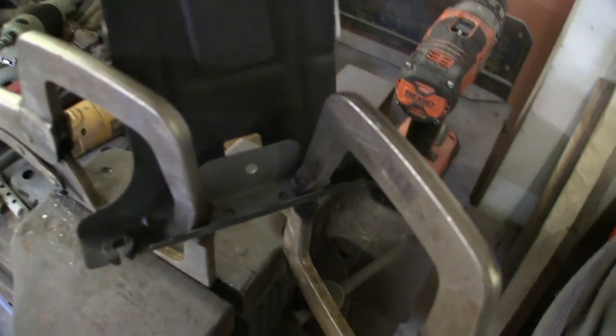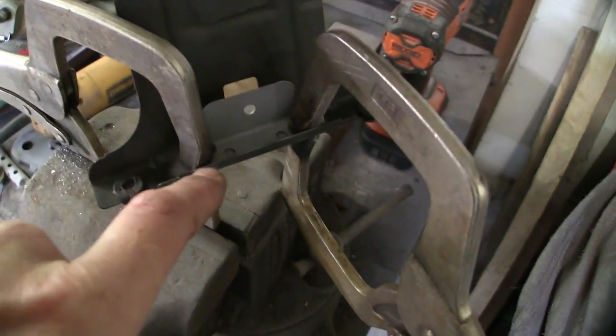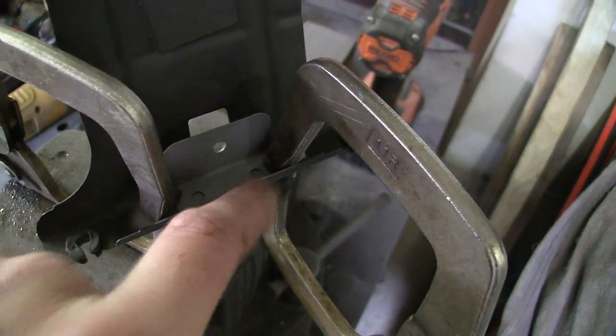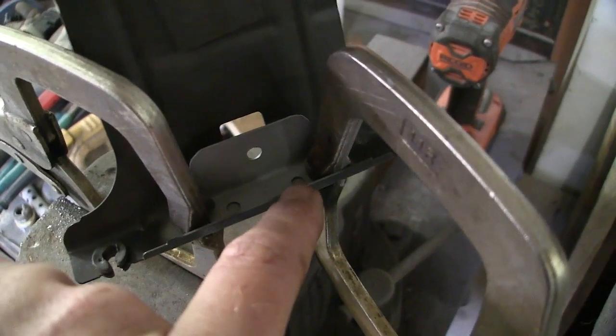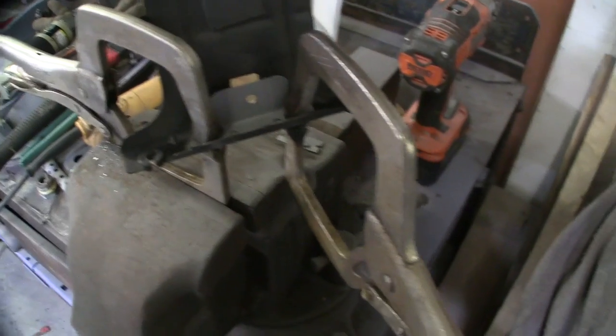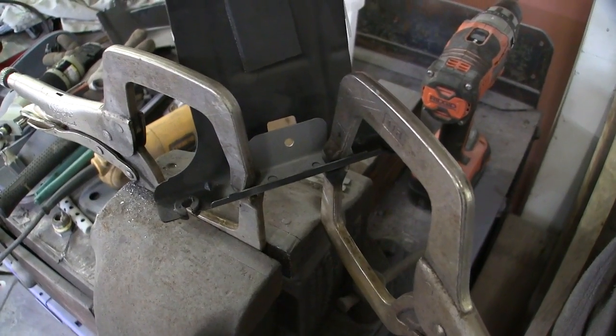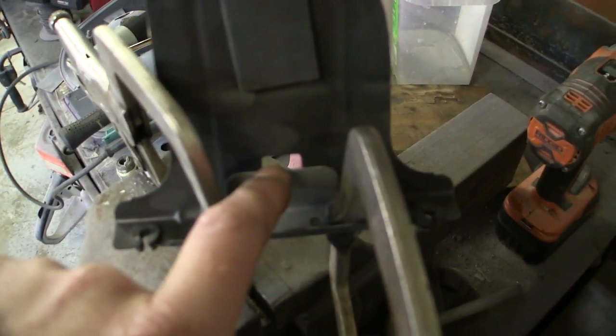Here's kind of what I devised. I've got this shiny new piece of metal in here with the hole in the same spot. I was going to bolt it but I changed my mind — I punched a couple of holes in it with the old flange punch tool and I'm going to put a couple of plug welds in it right there and there. I didn't want to drill any more holes in the bottom since there are already a couple there. I'm going to double-check this before I go welding it up — 99.9% positive I've got it facing the right way. It looks like the little rubber isolator pad is toward the bottom and the finger things are toward the top. It has to only go one way because that's where the tab that ripped out was.